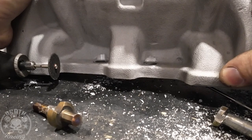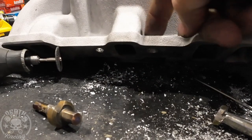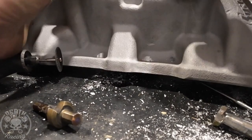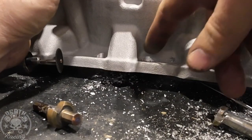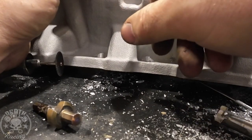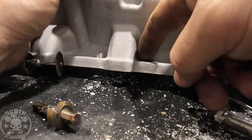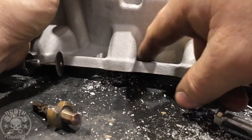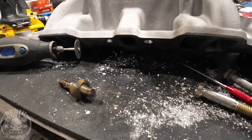I don't think you can make those surfaces much worse, so I don't think you can screw it up. With the factory hex head bolts, before this fix, it just tightens down on that inside edge — basically turning the head of the bolt to try to tighten it down. So all your load is on one side of the bolt, which is not ideal. That's probably why these manifolds are always filled with oil.